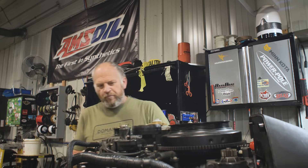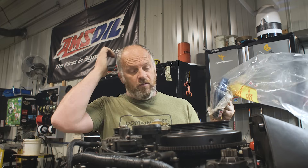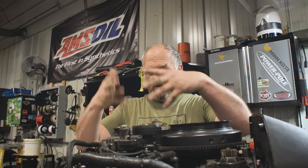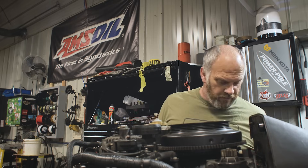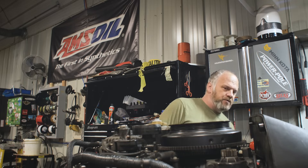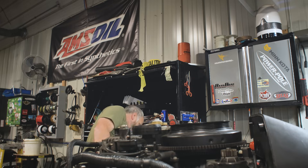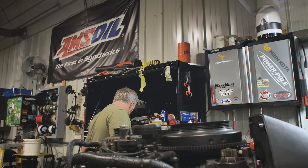Talk about bagging stuff - everything we do here, we bag everything per what we're doing. I've done so many of these I'll probably just bag all this top stuff into one bag. I would recommend if you've never done one, individually bag for what you're doing. Same with oil lines - you're going to want to mark your oil lines if you've never done one, so you can reference back on where they go, because you'll get to a point where everything is the same length and one wrong oil line and she's all done.